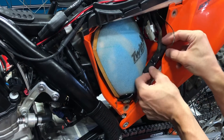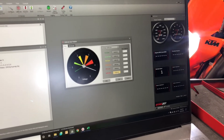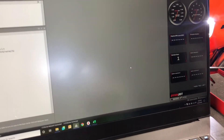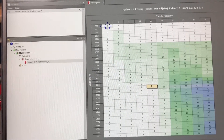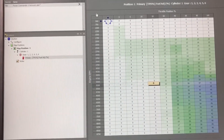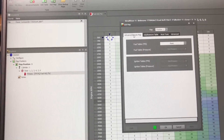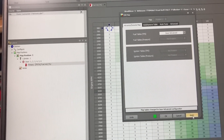The input side is done. Now we just have to set it up in the software. We should have gear position when we go through the gears, going back down to first — there we go. Now that we have the wire set and gear position calibrated, to set it up for different maps you come into Advanced, then Moto Maps, Advanced, Fuel Table, Gear Advanced, and hit Apply.